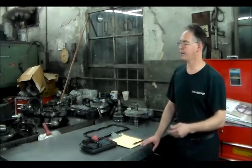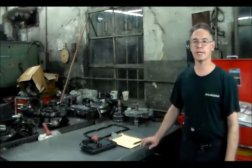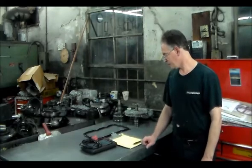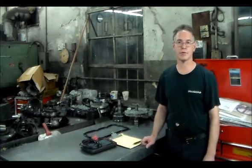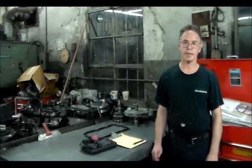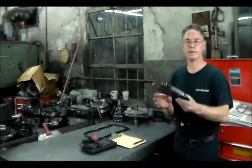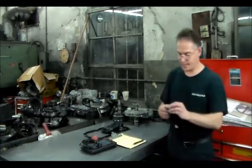This is an '08 with 170,000 miles on it, so the guy obviously does some driving. Eight bolts broke — I finished drilling that out and tapped everything. I'm going to be going back up with the pan today. Here is your filter — I'm going to be putting a new filter in.